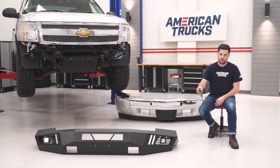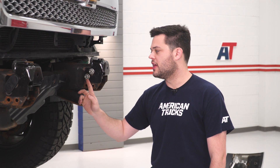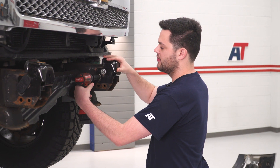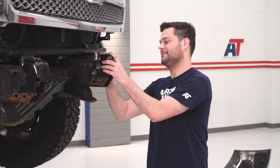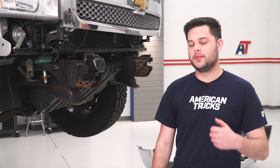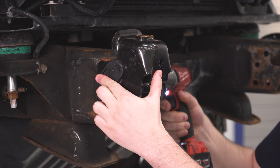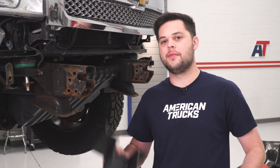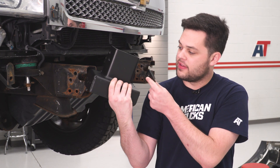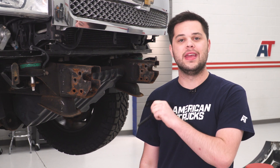We have a little bit of a mounting bracket to install before we throw this bumper up. Here you can better see what I mean — two 21-millimeter nuts with a bolt plate on this side. We're gonna loosen those up and get this mounting bracket off. We're gonna do the same thing for this side as well. Next up, we can grab our new mounting bracket — it's stamped on this side with a P for passenger. That's where we're gonna start, and it just sits on top of the frame rail. Once we have it in place, we're gonna secure with the longest bolts in the kit. One thing to note: you are gonna need this spacer right here for the inside of that bracket.